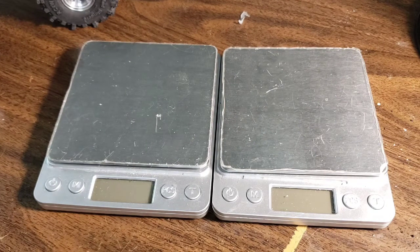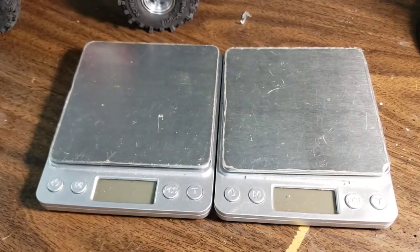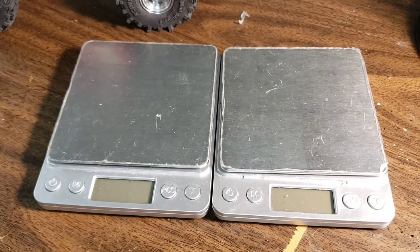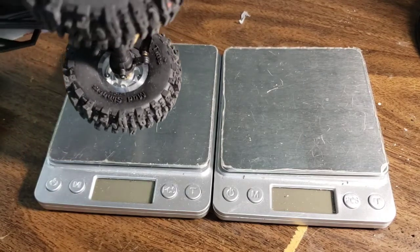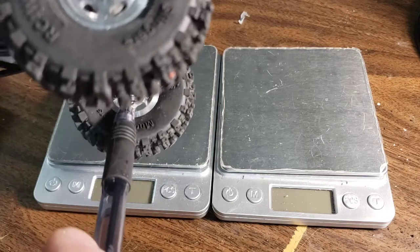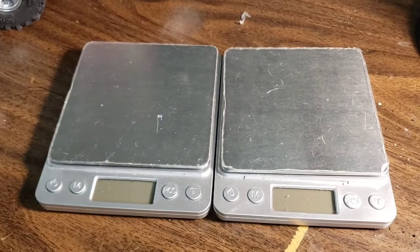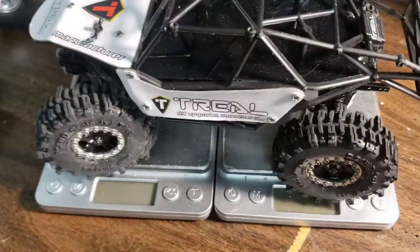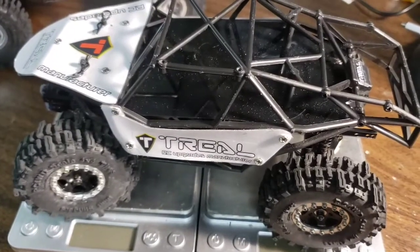I'm gonna pull out that rear diff cover on the back, throw a stock one back on, and just accept the fact that I'll lose just a tiny bit of side hilling. I'm not too worried about it, and if anything, I might try to see if I can throw some wheel weights inside the dish here, so that would make up for it. I've been running a little bit too nose heavy on the bias, and I found it out with the Trailmobile here. So I hope it helps you.